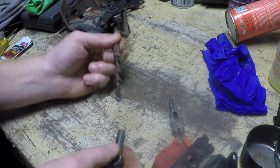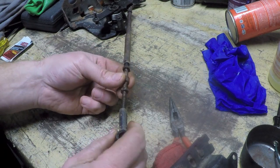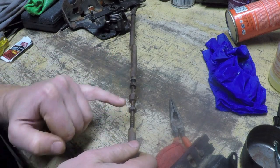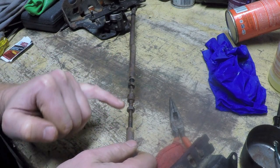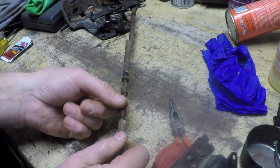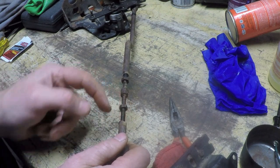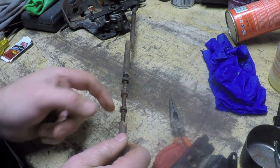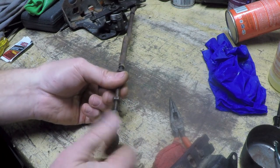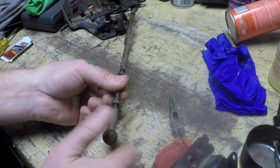They're actually not that bad — there's very little play in them now that I feel it. The play is in a direction that isn't as critical. I really don't want to wait for another order. So I'm going to go with the old ball joints. It's dark outside, so I'm going to have to wait until tomorrow to reinstall this. But I did one more thing before calling it a night — I cleaned up these threads and ran the nut down them with a little bit of tap lubricant. These threads are now working perfectly fine. As bad as they look, they're actually pretty good.